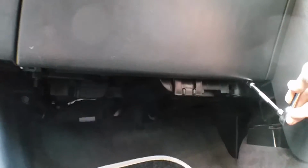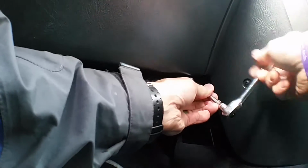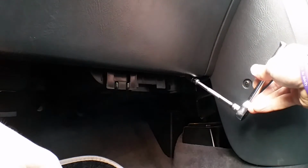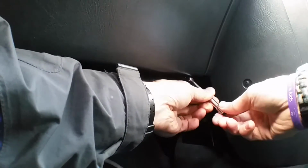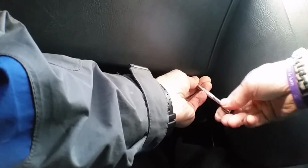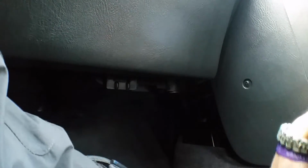And also, what's happened to me before was I thought my fan wasn't working very well. It had lost its power. I thought, oh, the fan's on its way out, I'm going to have to have all the hassle of changing the fan now. But what actually was, it was the pollen filter. It was really badly blocked up. So once I replaced it with a new one, hoovered out all the muck from the housing, it was back onto full power. So just a quick and easy change, saved a lot of trouble. Okay, so that just lifts out.